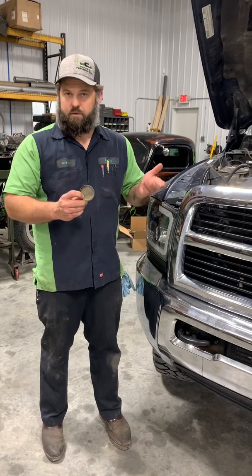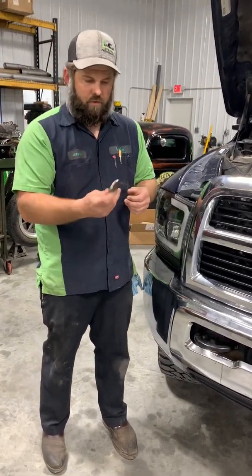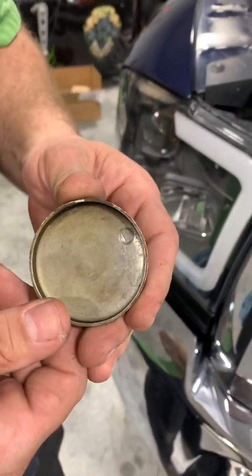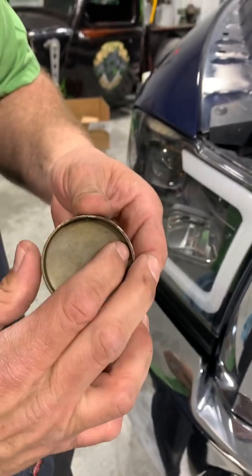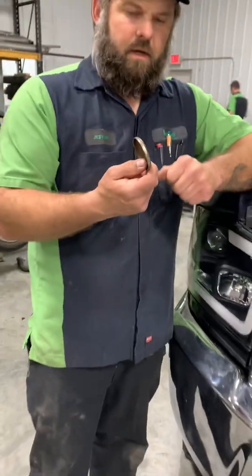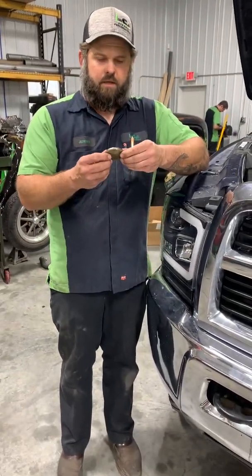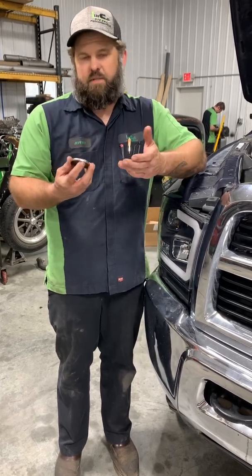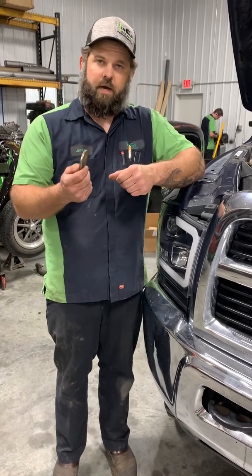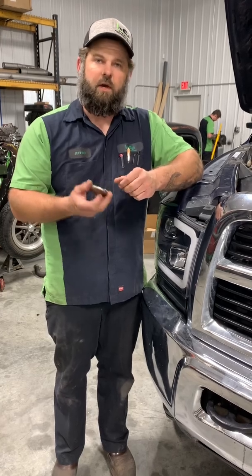About three minutes or less — that didn't include setting it up, but very quick, easy, and non-invasive on the block. So we demonstrated our method for getting this plug out. You can see the plug that came out — the original plug — and you can see how our pusher bolt was all the way over on the corner. That's the key: cocking that plug to pop it out. Including time to chase the bolt holes and clean out and prep, you might have 10–15 minutes in this whole operation, and you don't have to worry about damage to the block. Just follow Fleece's instructions on the kit.